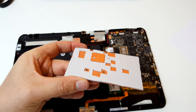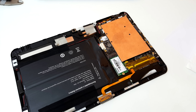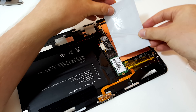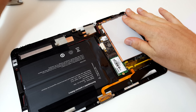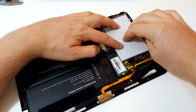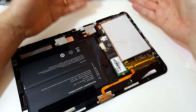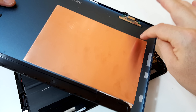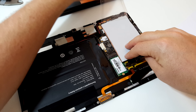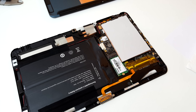In the end I had to remove the thermal pad underneath — it's just too thick. You'd probably have to use only half a millimeter. What I did was put insulation tape all underneath it and screwed it on. Now I'm going to put a two millimeter thick thermal pad on top of the whole copper plate. I'm hoping it's not going to be too thick — if it is I'll have to reduce it to a one millimeter pad, because if it's too thick it could apply pressure onto the screen or prevent me from closing the back, which has the copper foil that should transfer a good amount of heat.